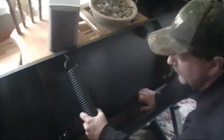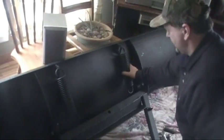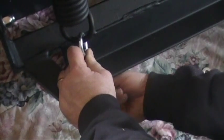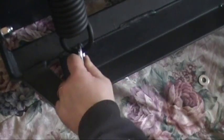What we're going to do now is hook the springs in the top of the plow. We have two big springs here and I'm going to go in the top of the plow and just tip them and turn them in like so. I'm going to hook these eyelets through the springs and tip this plow back. That will allow the eyelets to start through this hole. I have a flat washer I'm going to put on there, hold it in place, then take another lock nut and put it on underneath and just start it on. There's going to be enough tension on these springs just to hold this in place as we go.